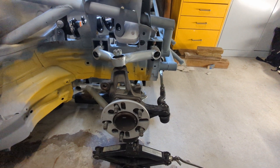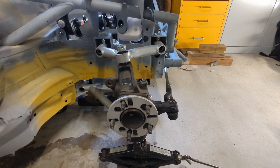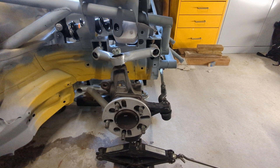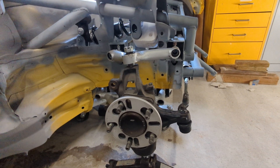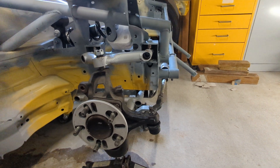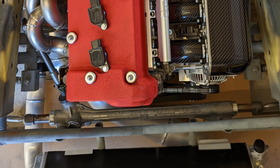The length of the control arms also has some effect on the turning circle. Being a race car I wasn't too worried about that, but it was something I had to consider with such a wide tyre. The other important part of the steering was the fact that the steering rack is now in front — what they call front steer instead of rear steer like the original design — and I had to make sure the steering rack was actually going to clear the engine. The engine can only go so far back under the rules, but I still had to fit the steering rack in front of the engine without fouling on the crank pulley.